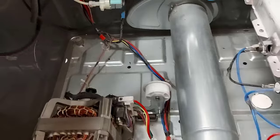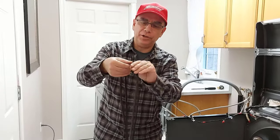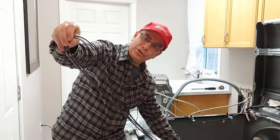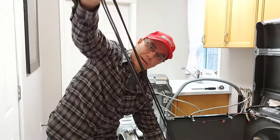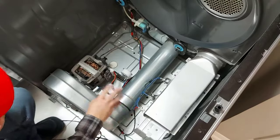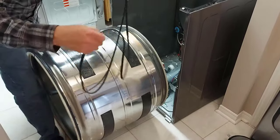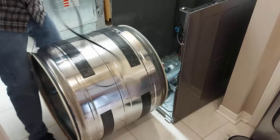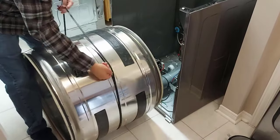Getting back to the video — we're going to take our drum belt out and replace it with the new drum belt. I got my new belt out of the package and I'm just going to make sure it's the right length, the same as the other one. That's why there's a spring-loaded idler wheel, because sometimes belts will stretch. The original one may be stretched a little bit. I went ahead and vacuumed everything up. Now we're going to wrap our belt around our drum — you have a flat side and a rib side; the rib side of the belt goes on your drum. We just slip it over the drum, rib side down.